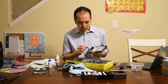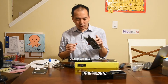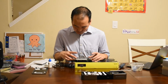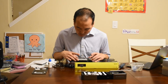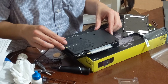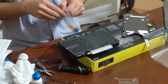We do have to remove this tray so that we can place the card onto it. We're going to remove the plastic piece here that protects the new thermal paste, then line up the holes and drop the card into place so it presses into all the right spots. All the holes appear to line up, so we just put this where it needs to go. That looks right to me — and then all the screws appear to be the same, so we put all the screws on.